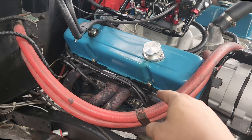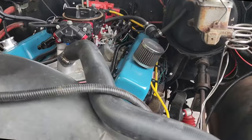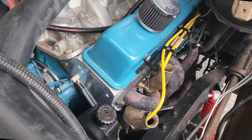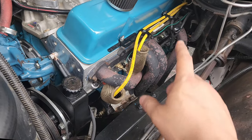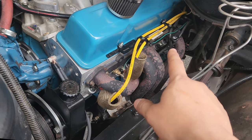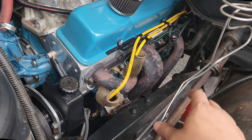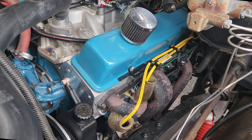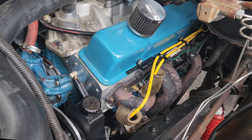If you're going to pick these heads, don't do the angle plugs. I did that and ended up having to dimple one of the exhaust primaries — that's the number one tube right there. The problem is the headers are really tough to get either a socket or a wrench on with angle plugs because they're designed for straight plugs. Using angle plugs with straight-plug headers means you're fighting yourself. I'd pick the straight plugs. Yeah, you miss a few horsepower, but unless you're running a crazy all-out race build, you really won't notice.